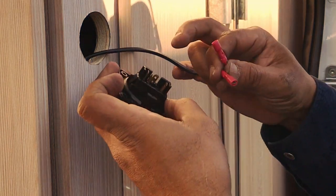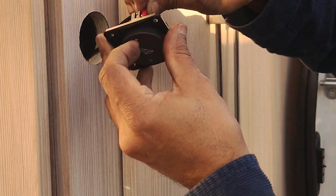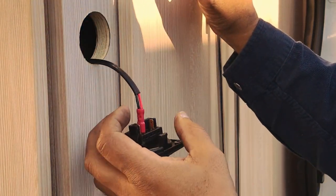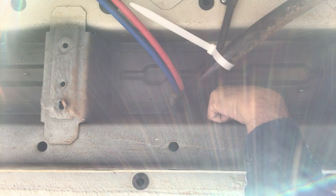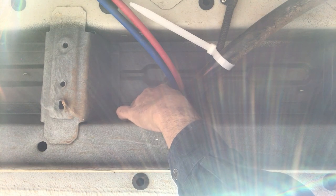This is the power connection I set up last night. Negative has to be on the vertical - that's the vertical one there, and that's my black cable - so I'll go ahead and click that in. The one closest will be positive. I now need to think about how I want to run the cable into the van. I need to decide whether to be on one side of the hot water pipes or the gas pipe - from a safety perspective.